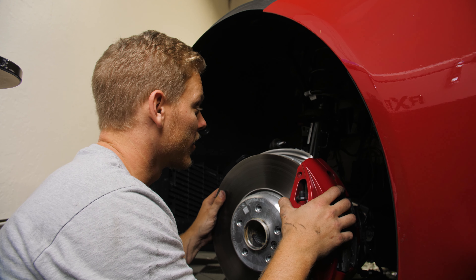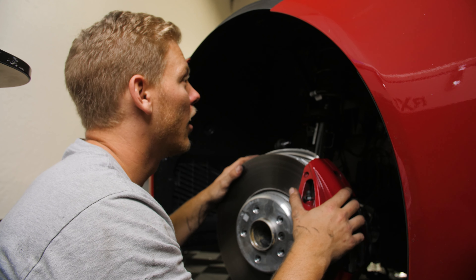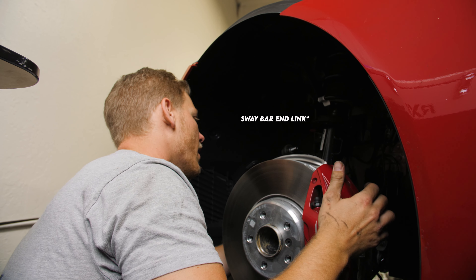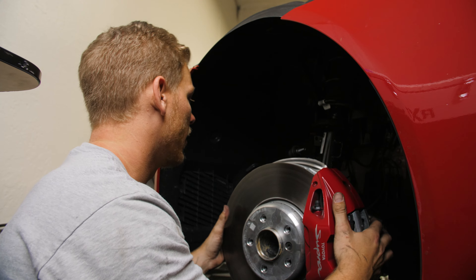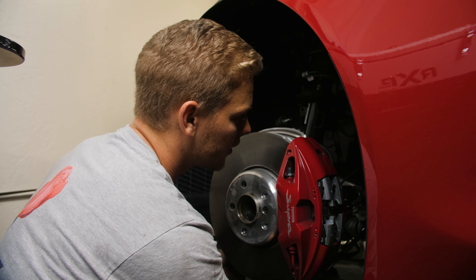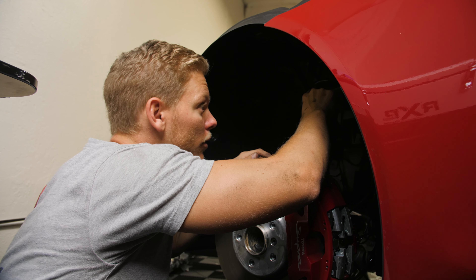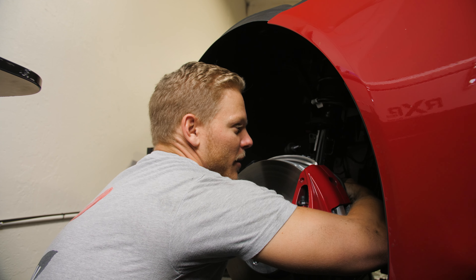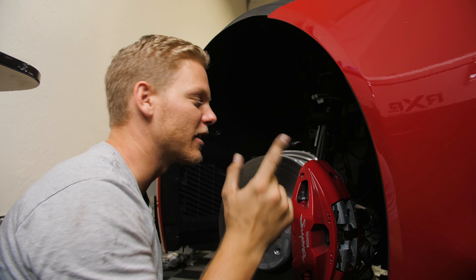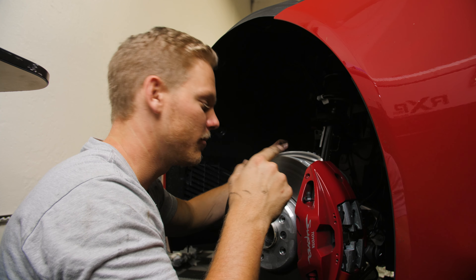The other side was a bit of a learning experience. It's my first time putting on coilovers. My dad helped me out, called up Alvin at one point from 3RA Motorworks. The hardest part: there are all the little electric parts that come out, little sensors, the sway bar comes out right here. Then you loosen up the lower control arm down here. On top of the actual shock there are four bolts that come out, and then this whole thing has to tilt forward. The problem is there's a little thing back here where you basically have to wedge a pry bar in the back, push this down and get that to come out. That was the hardest part on the other side, so this side's been moving a lot faster so far.